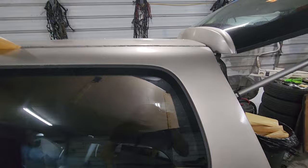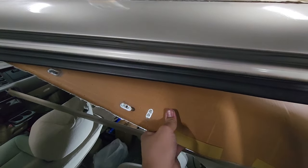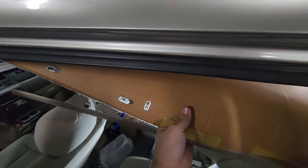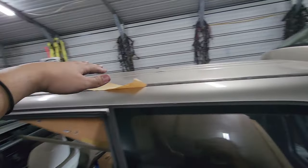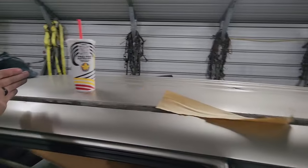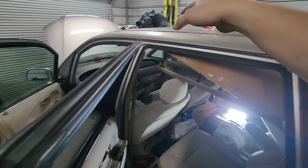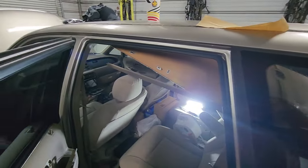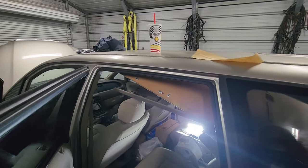I've got three or four layers and I'm gonna put the headliner back up which'll be an extra little layer of protection. The foil-looking silver stuff deflects sound away, so the beat should bounce off the roof and travel forward. From the box, the sound will come up, hit the roof, and travel forward. This isn't an SPL van — I just want it to not vibrate with that weird resonant noise.